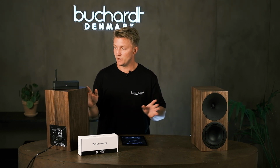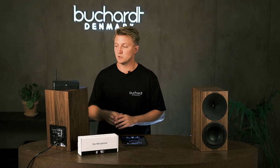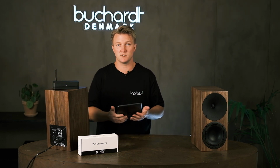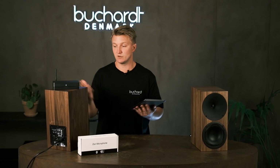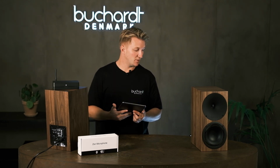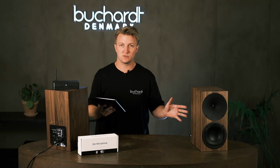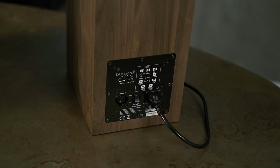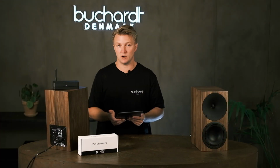So that's pretty easy. You have a pairing button on the back of the hub. You just press that once. You can also do this within the app from the settings, but found it to be easy to just press the physical button. Give it some time, and when both speakers are connected, you will see that the wireless LED that was flashing before will now be solid white, and that means that it has paired to the hub.